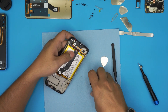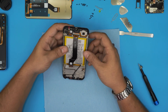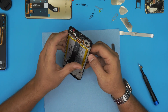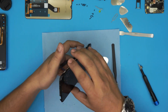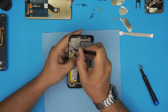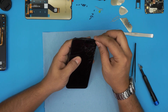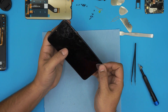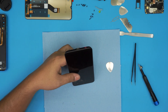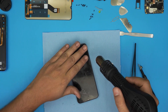It should just pop out, and that's it. This is the flex cable for the screen — you can go ahead and cut it if you want. We're going to leave the battery in there and not remove it. All we need to do is heat up the screen to remove the adhesive. The screen can be punctured right through, but just leave it. We're going to heat it up and with the opening tool we'll start from the side that has less damage. Heat it up with a heat gun at about 80–90 degrees Celsius — make sure it's warm to the touch.